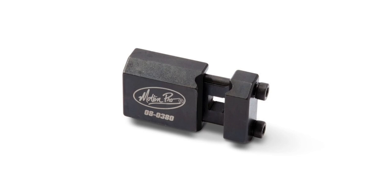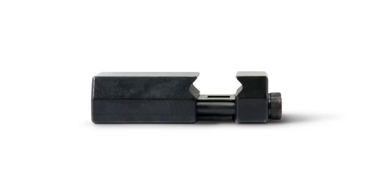I can't say that there's any dramatic change as far as steering feel goes, but I took it very easy because I want to wait until I get everything torqued to spec before I really wring the car out. I did also order an add-on for a box wrench that allows you to use your torque wrench, so I can get those other bolts torqued properly, the ones that I could not reach that you saw in the video. Once I get that all squared away and get the little piece for the electronic leveling on there, I'll take the car up Mount Lemmon and really let you know how it does. But as far as the clunk, that's definitely gone, so that's cool. I still will do the tie rods here in the next couple weeks probably, so I'll get a video on that.